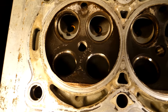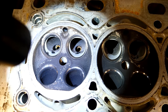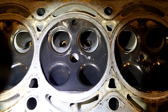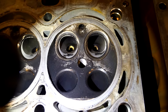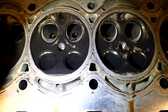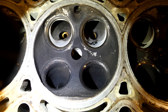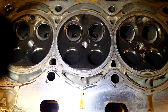The same imperfections can be seen with the cylinder head flipped upside down — irregularities in the casting for each combustion chamber and the exhaust ports too. I'm going to first sandblast the entire head to remove all the carbon and dirt. You can also hot tank it or use any other cleaning method, but sandblasting is faster and more effective at breaking down surface imperfections and removing carbon, oil, and soot. At that point, all you'll see is the roughness, casting marks, and ridges.